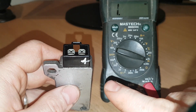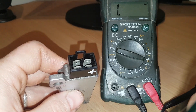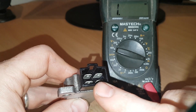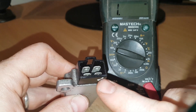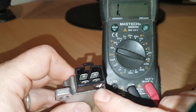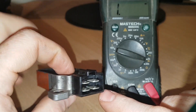All you really need to know about this is what it does. It converts the AC current from the stator and converts it into DC current which charges the battery. If this unit doesn't work properly or it's sending too much current to the battery, you'll destroy your battery, or the bike will eventually stop because it's not charging the battery and will just drain it completely flat. So it's a pretty pivotal unit to the electrical circuit on the bike.